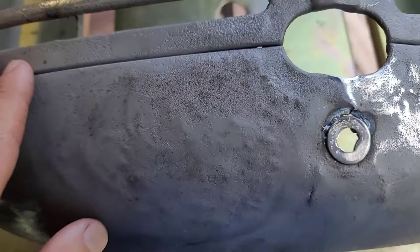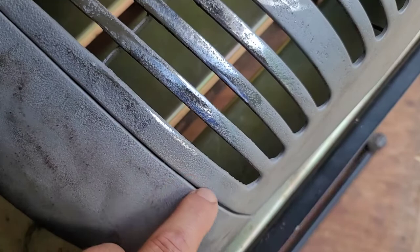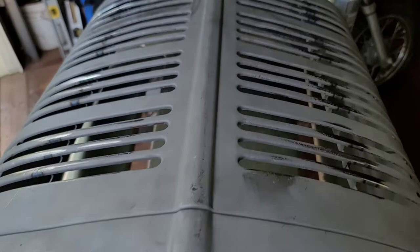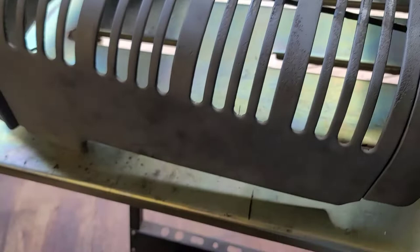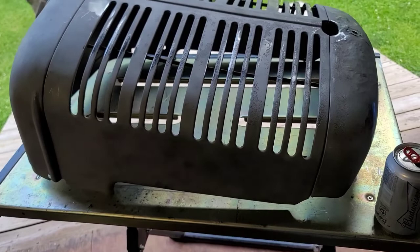This whole thing was in really bad shape — all the factory welds were broke loose through here, it was poor work. This side here was the same thing — you can see where the heat penetrated. But she's looking pretty good now. It's gonna look really good once it's all body filled, the high-fill is done, and the pits are gone.